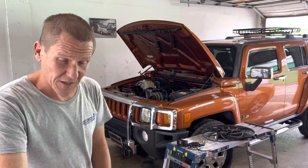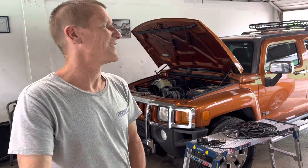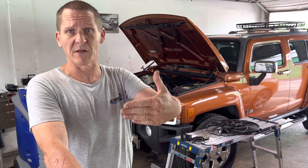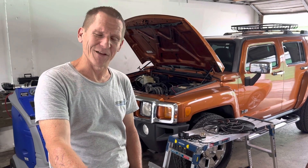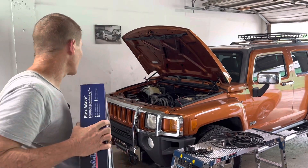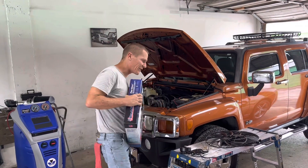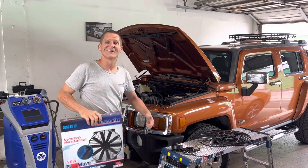So I've clearanced it as much as I can. If this doesn't fit, there's a good likelihood we're going to have to go get something like an LS3 water pump for a Corvette and get spacers to space it forward until it lines up with the truck belt spacing — and I hope that's not what we have to do. For now we just need to get this fan in and see what we get. Hopefully it fits. I'll make another video when all this is done. Second shift performance.